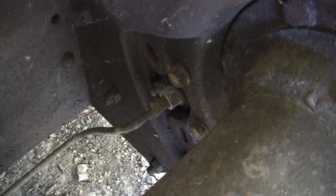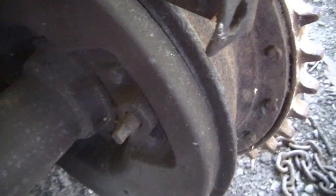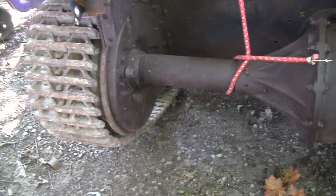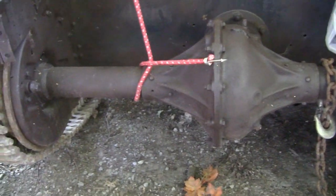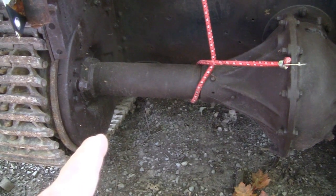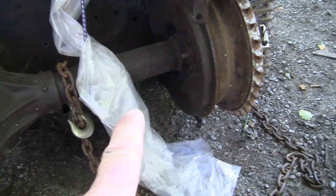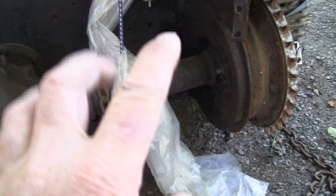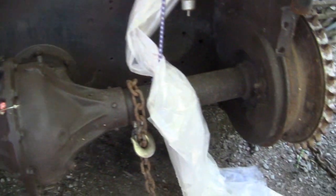You can see the wheel cylinder's crooked down there for some reason. This was mechanical brakes to start with - they converted it over to hydraulic brakes. Now these rear ends of these Bren guns are the same as some of the military vehicles of that era. They just use the pieces from one to the next. You can tell this hasn't been replaced with a truck rear end because it doesn't have the brackets for the leaf springs on it.